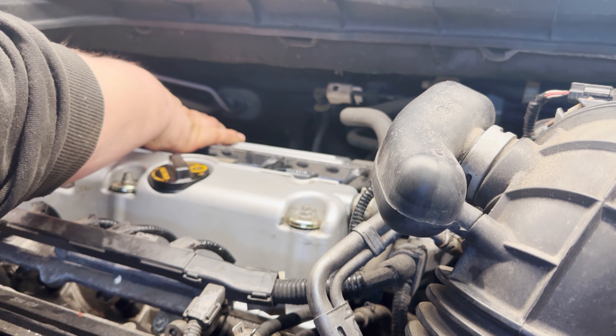Come to the top of your engine, open your hood, put your prop rod up. There are four 10mm bolts on this plastic cover — these just hold down the plastic cover. Then there's a wiring harness that they hold down on the backside. Pull that up and it exposes your ignition coil packs.